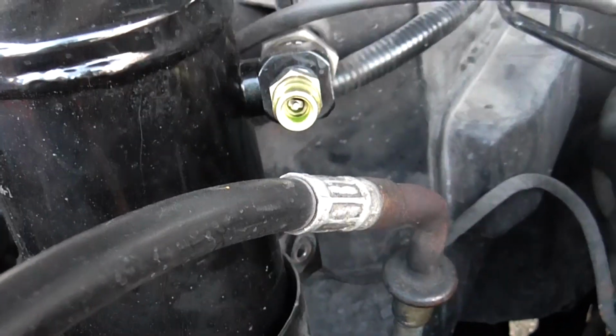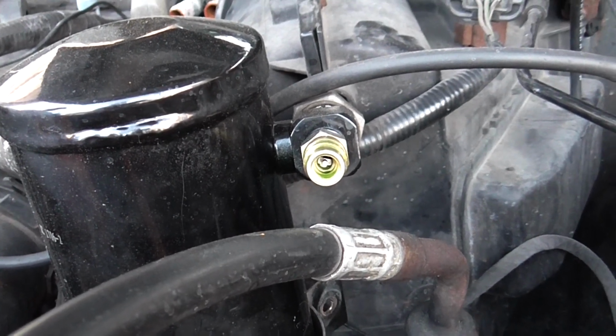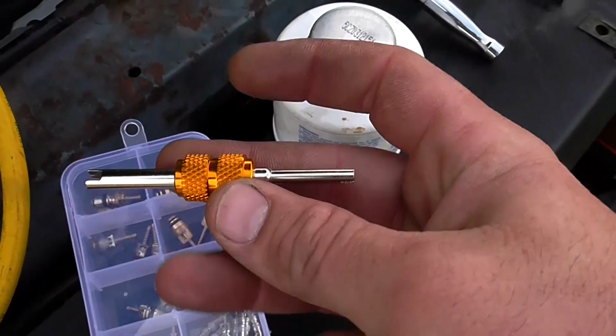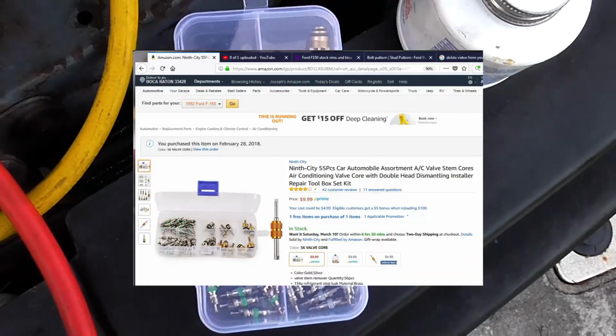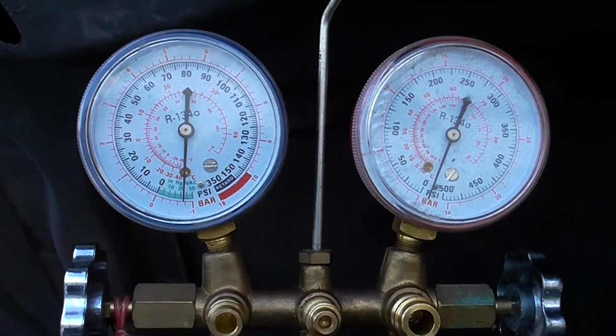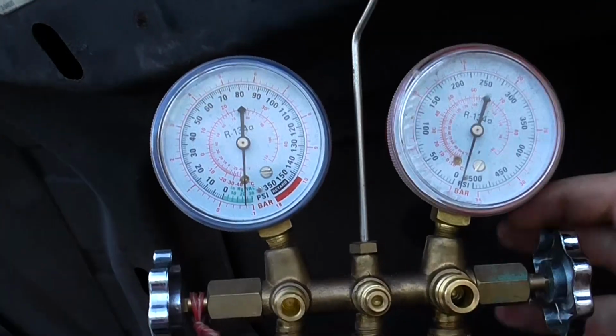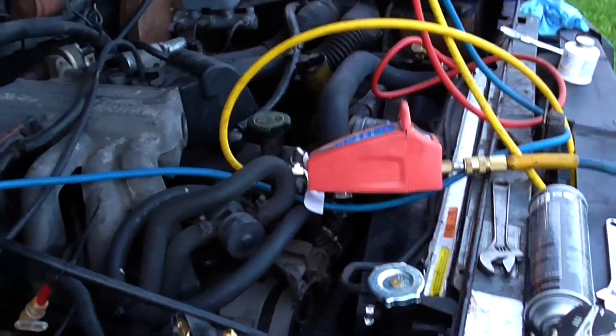Alright, so now the other thing that was leaking for sure is these Schrader valves. I think this is a 134 adapter. It used to be R12 on this years ago. So I got a fancy looking tool and then some valves from Amazon. I'll put these up in the description or whatever. We'll replace these and bring it back. Alright, we'll see how this goes. Let this run for a while.